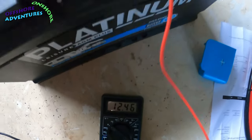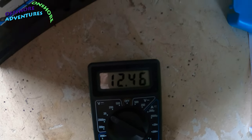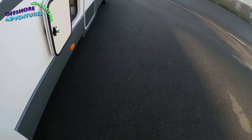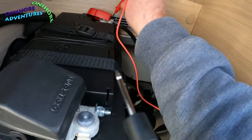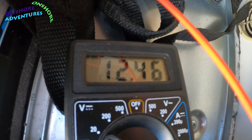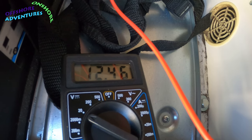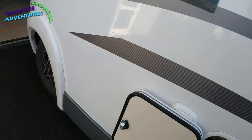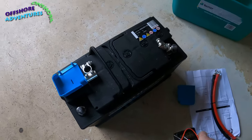That's 24 hours later. The new battery we bought is hovering around 12.46-12.47, very similar to yesterday. And we'll do a quick check of the one on the van that's been disconnected from the electric hookup for 24 hours now - and that one's come down to 12.46 as well. So they're both exactly the same - that's the perfect conditions under which to link the two, so that one doesn't adversely draw on the other. Next job: getting it fitted in.